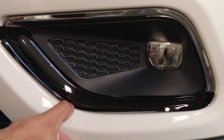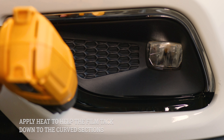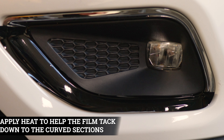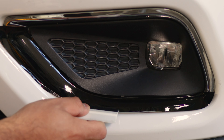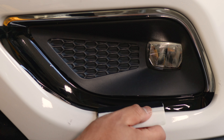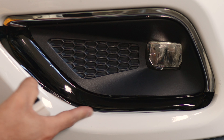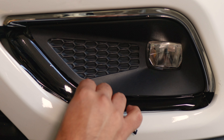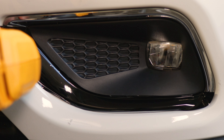Now all we need to do is help it tack down around the curve. When applying pressure on the curve, the film may still lift. In order to help it tack down, we're going to need to apply heat — that way it releases the tension and we can tack it down underneath. Apply heat on the entire lower section of the panel. After each squeegee pass, bring it back down and make sure everything stays flush with no fingers. If there are any, just lift the film back up, reapply heat, and finish off the rest of the panel.